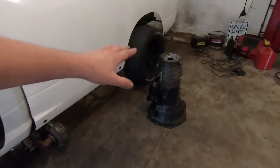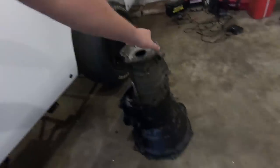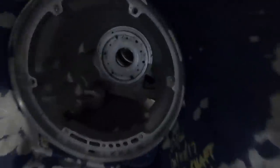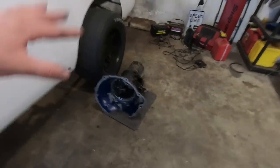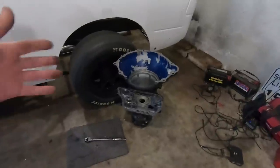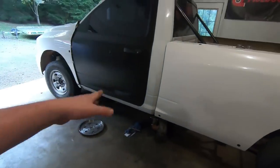This is not our 48RE back from Muldoon's — this is my mock-up transmission, because everybody's got to have a mock-up 48RE. As you can see, it's completely empty — just an overdrive housing and a main case. This was actually the original 48RE we had in the truck. One time torquing down the pump bolts, the aluminum actually broke on the case, so we had to get a new case back then. But I've actually used this mock-up case multiple times for little projects on the truck while we didn't have our full 48RE, and it's a good deal lighter.